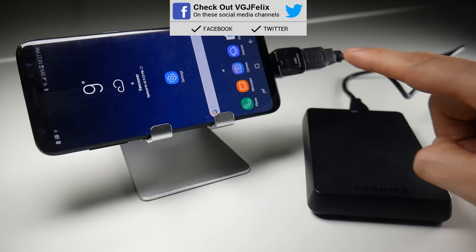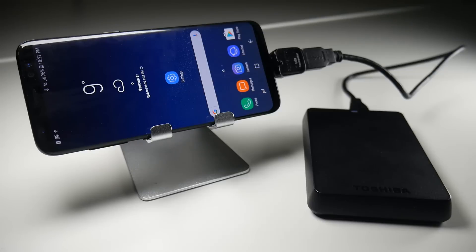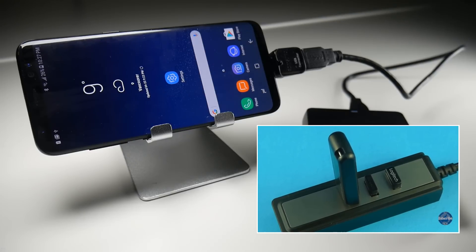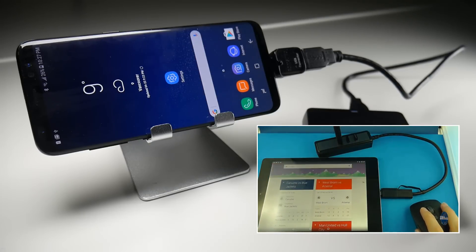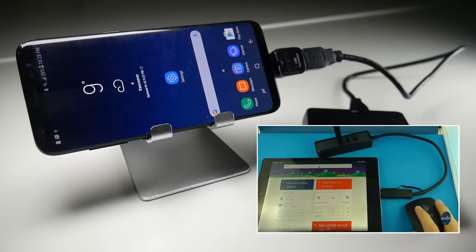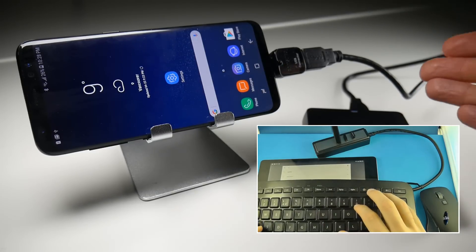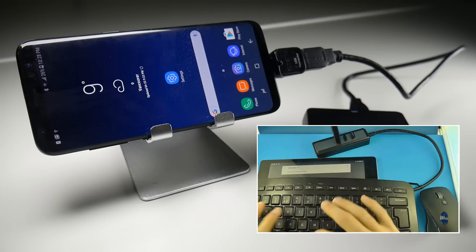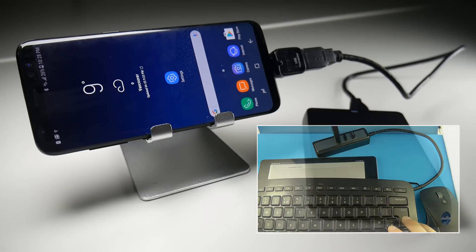So it looks as if, for the time being, with the USB connector you can plug in mice and other low-powered peripherals and flash drives for expandable storage. It's a case of experimenting and seeing what you can do — you can certainly do it with keyboards, for example. The possibilities could be endless depending on what you want to use it for. Effectively, if you have enough USB devices, you could turn this into a mini computer. I've done it before with a four-way USB hub on a Nexus 9 and been able to use multiple things at once. Just be careful with hard drives — there may not be enough power and that could corrupt them, so use certain peripherals at your own risk.